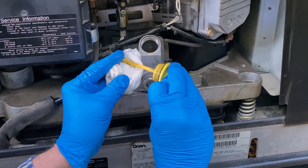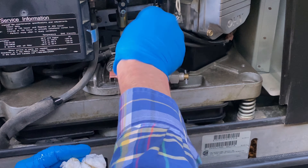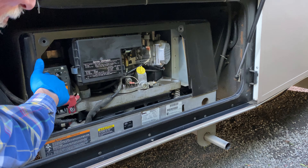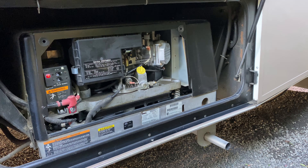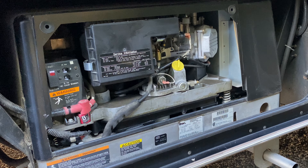I'm going to pump out some more oil to see if I can get the level down closer to the bottom of the dipstick. Still about a third. I'm going to start it up and see if anything happens differently. Well, that's not good — it quit right away. Flashing one, two, three. I'll check the codes on that and see what's going on.